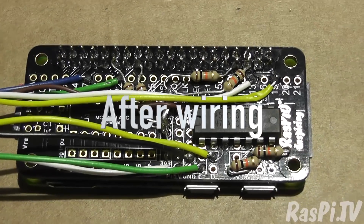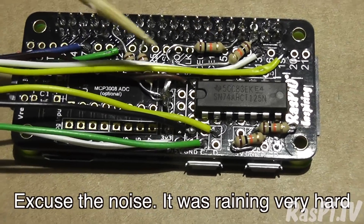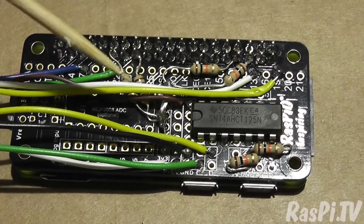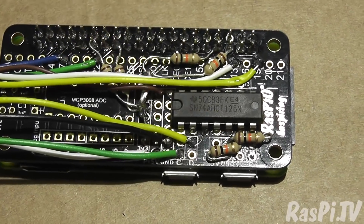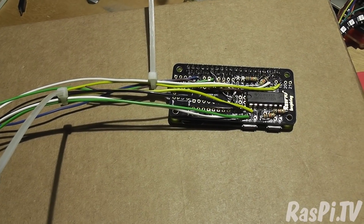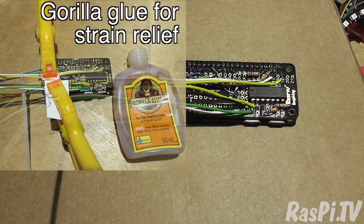Just a very quick look at the board that I've made up. We've got all the wires for the buttons here and all the wires for the LEDs here. You can see there's some pull-ups for the buttons and pull-downs for the clock and data ports. Because some of the colors are overlapping, I've used cable ties to separate out the groups of wires so I don't get confused.